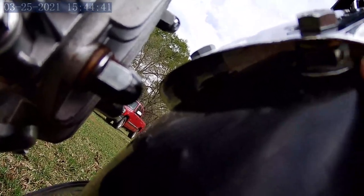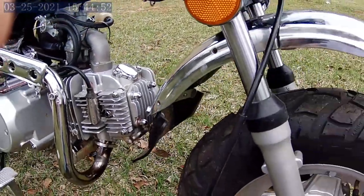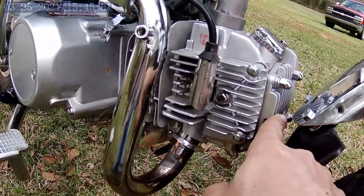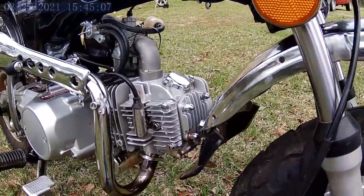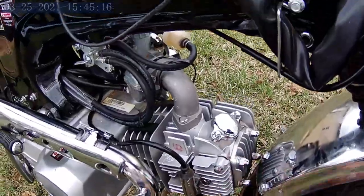What I did was space the mud guard forward using longer bolts, a nut, and some quarter-inch aircraft washers — just stuff from a junk bolt box. The neat thing about this is that now when airflow comes up under the fender, it goes through the gap and blows across the front of the cylinder head and up under it. I believe it helps with cooling on the motor, and it will definitely help keep sand from being thrown up onto the cylinder head and onto me.